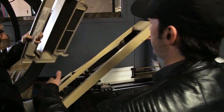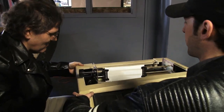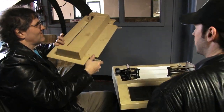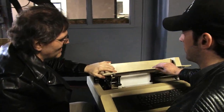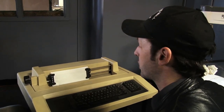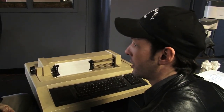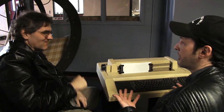The next step is to grab a desktop computer. We need a DB9 to DB25 adapter. I've got a DB9 cable to get from the desktop computer over here, and then we may need a gender changer or a null modem adapter. I've got all those for DB9 but not DB25. Hit a local computer place and grab it real quick — let's rock out. I'd like to get this working by the end of the day. It should be pretty simple on any Linux machine; you just set this as TTY and go. With Windows you hook it up with HyperTerminal, but with Linux the whole TTY concept is really easy.